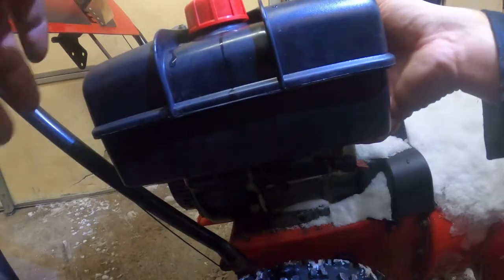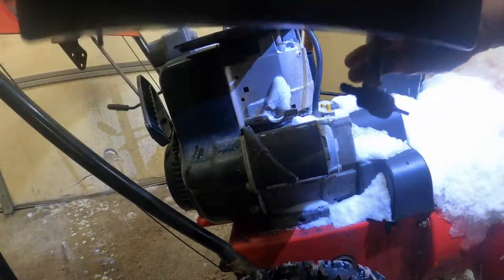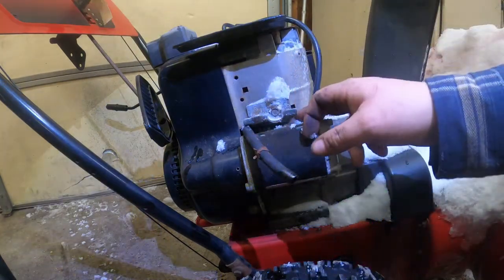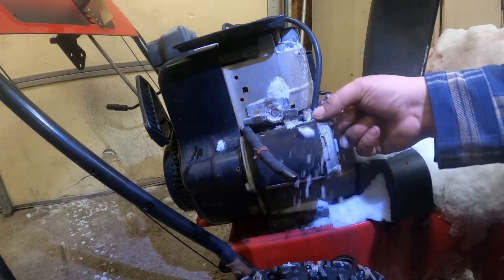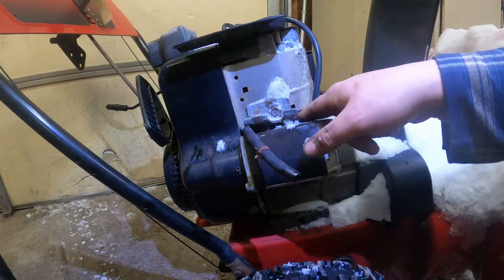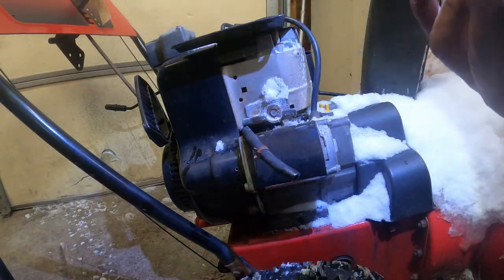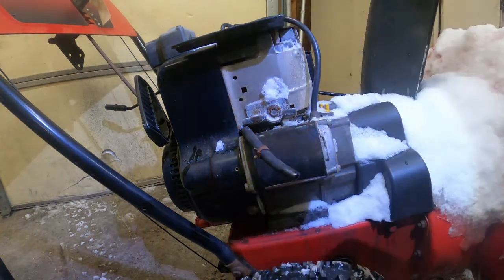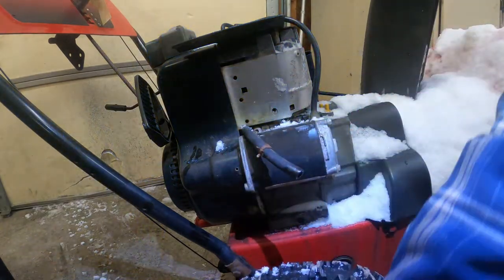So now what I do, I tip the top down and out, and then I pull this top part off, okay? So now there's this bolt here, right? Now these are slotted on the top, I believe, but we're gonna take it apart anyway instead of just loosening it. So I'm gonna take this bolt out. The top bolts are 3/8 that are in the top of the gas tank. This one is a 7/16. Just take this bolt in this bracket, set it aside.